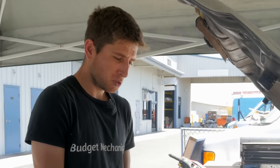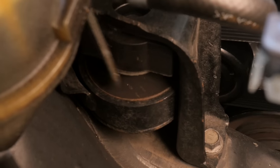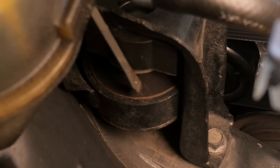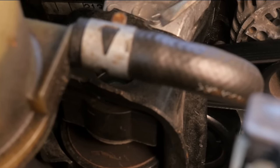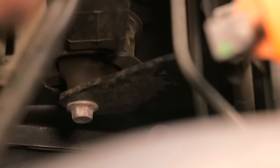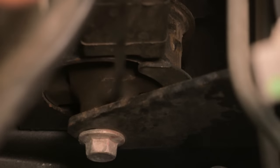The movement in this engine looks pretty normal, but I'm going to go ahead and check the individual mounts for any signs of wear. Often one of the easiest mounts to see is on the passenger side. What you're looking for is the rubber area — this is solid rubber that will start to crack, big chunks can fall out, and it essentially just breaks down. Then metal starts hitting on metal. But this one looks pretty good. Here's the one on the front of the motor on this car — again, this center section is all rubber.